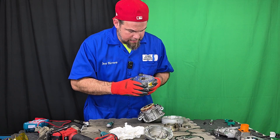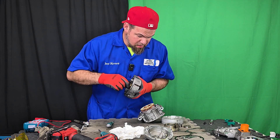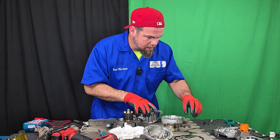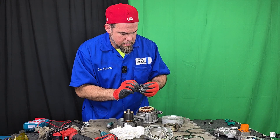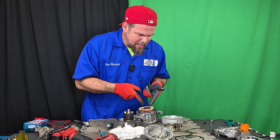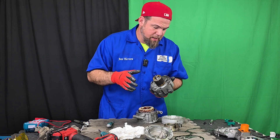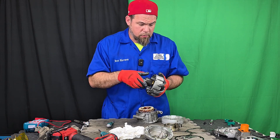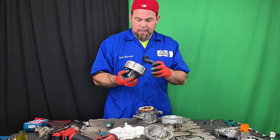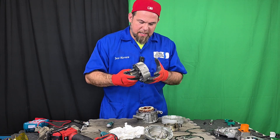As I can see, this is a CW bearing made in China — a Chinese bearing. The bearing in the back is an NSK Japan bearing. The bearing in the front is also a CW from China. Why do we have NSK Japanese in the back and Chinese bearings elsewhere? I have nothing against the Chinese, but the quality is obviously an issue. To be fair, Nissan e-powered cars are also having trouble with this and they use Japanese bearings, so I'm not sure what type of stress this kind of rotor puts on these bearings.